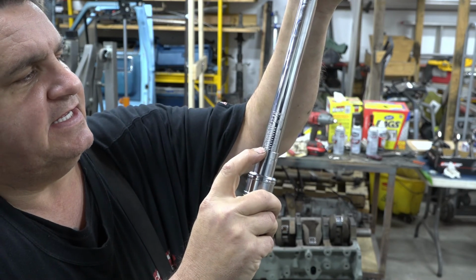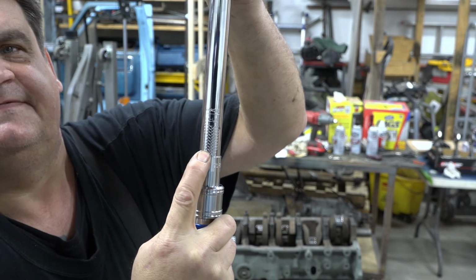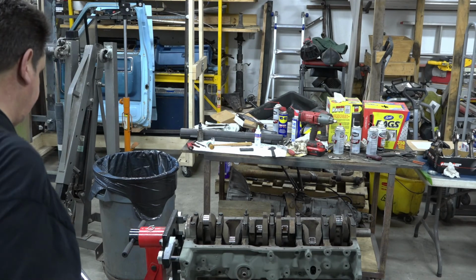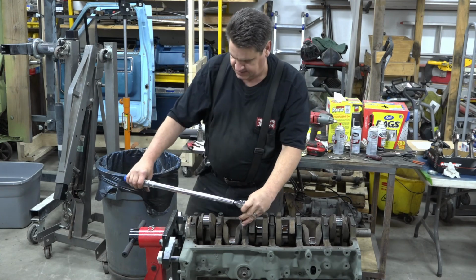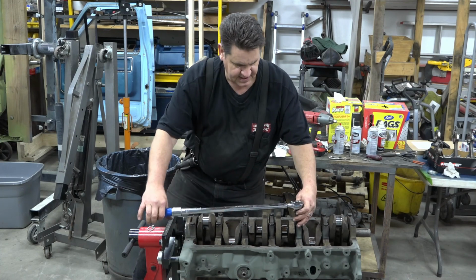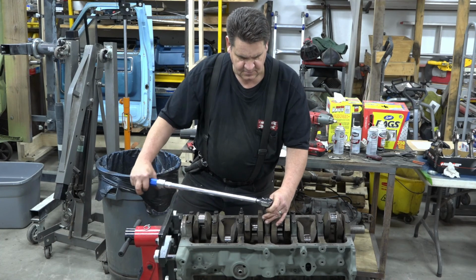Like this one is in 10-pound increments. It starts at 50. So with it on 0, and it may be kind of hard to see, but if you're on the 50 line and 0, that's where you're at, it's 50 pounds. And then as you turn around, you got 1, 2, 3, 4, all the way up to your next increment, in 1 pound increments. And we'll just go on like so. Just a gentle click, there's what you get out of these on the low end of their torque range. Then just go over them one more time.